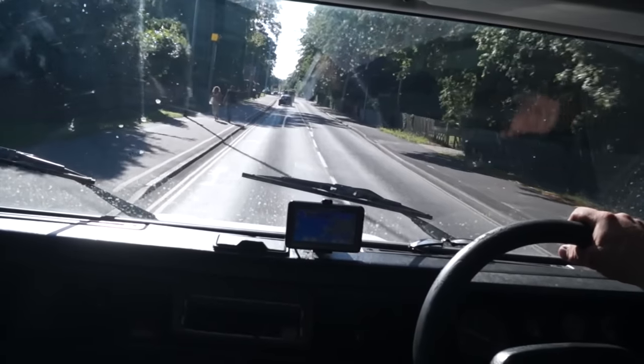I'm going to watch out for speed cameras today — not that we'll go too fast — but we're going to push this vehicle through a range of tests. The first one is to find a piece of road without a camber on it, ideally a secluded area with no traffic. Your vehicle has to be legal to take on the road. What we want to do first is make sure the brakes pull up evenly — this is one of the first checks you do on a road test.